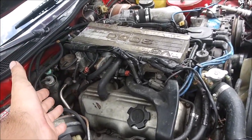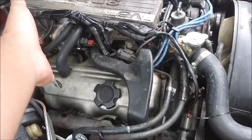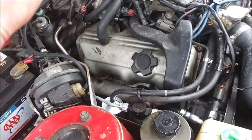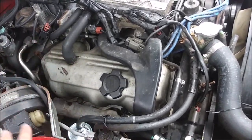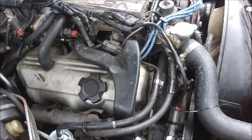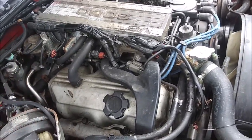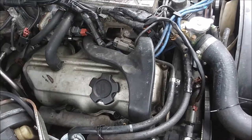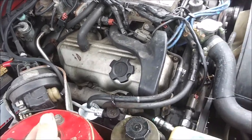Basically, make it feel a little more spirited. That's why I wouldn't mind just the factory turbo stuff — naturally aspirated engines have about 9.0:1 compression, and adding just 6 to 10 pounds of boost is still perfectly safe for 93 pump gas. That should bring it up to about 210 horsepower. The stock factory turbo engine had 7.8:1 compression and made 200 flat, so with a little more compression at around 7 pounds of boost it should be about 210-220.